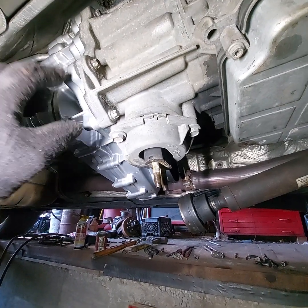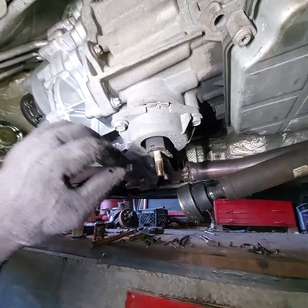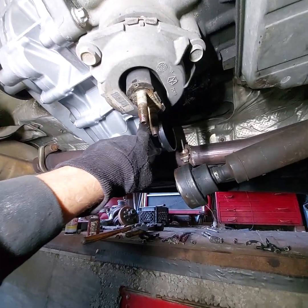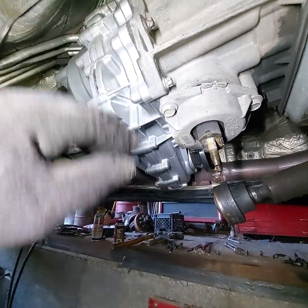And when you tighten them up, don't cram one down and then go to the next one. Tighten one a little bit and draw up about half your distance. Then go to the other side and draw it up and watch your gap as it closes in. Make sure it's coming in even all the way around.